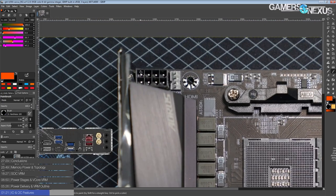We've also got a single 8-pin power connector on the board. A lot of X570 and even B550 motherboards will have an 8-pin and a 4-pin, or two 8-pins, but that's completely pointless because even a single 8-pin is more than capable of powering even a very heavily overclocked 3950X. Ryzen CPUs, as hot as they run, don't really pull that much power.